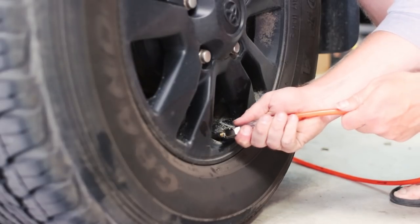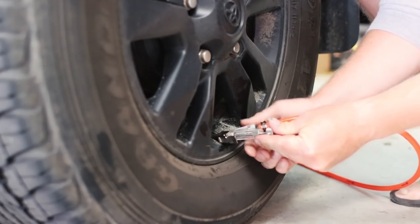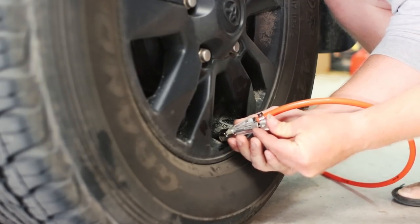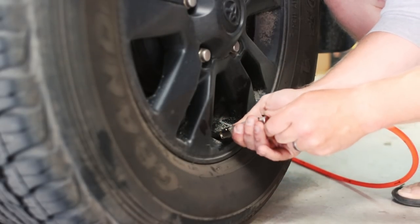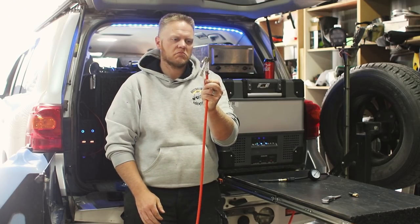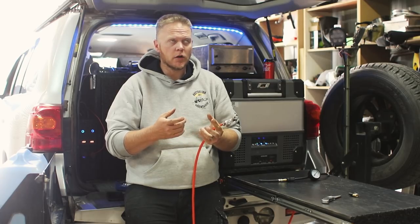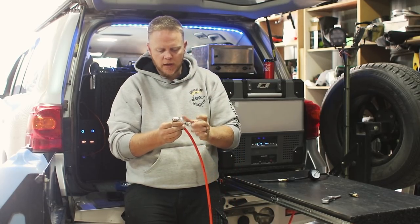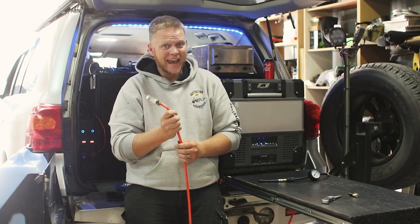So can you put more air in without having to pull a stem out? Kind of — let me show you. Once you put it on and push that in, you can actually push the valve stem in by pushing that in, which allows air to go in by itself. It steps up to 38 now. So for that last little bit of just checking the pressure, you don't have to take the valve stem all the way out. It's not a bad little gadget. It's a little bit fiddly getting the stem in and out, but a whole lot easier than those old ones where you've got to hook it on, push it in, hope you can get it, pull it out, and you can't see anything. Because of the clear tube on these, you can see when the valve stem's out and when it's going back in. Everything's nice and visible. Plus it's permanently attached as an inflation device, which makes life a whole lot easier and quicker.